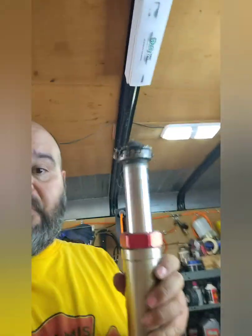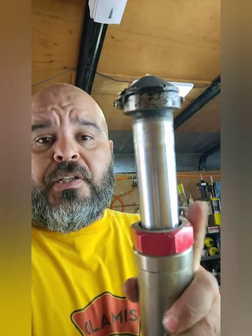My first step is to fully extend the shock. I usually just hit it with a little bit of shop air — put it in the Schrader valve just like you're filling it with nitrogen — just to get full extension, then I completely empty it out 100%. Don't forget that step. Sometimes the seals are so bad you can't fill them with air because they just bleed out, so then I force them apart.